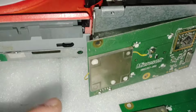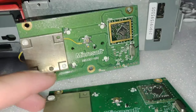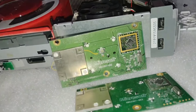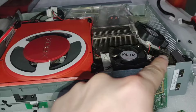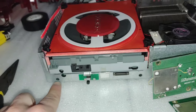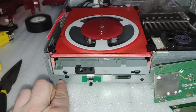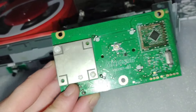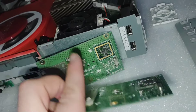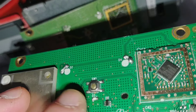To explain this yellow wire — it goes through there right to our speaker, and that's basically a signal telling it that it's powering on, which activates the power-up sound. There's another wire from that board that goes over to where the eject button is, and when you click that it makes the R2-D2 sound that's loaded on there. It's a signal wire to tell it to make the sound because it's turning on. We're going to desolder it from there — that's just where it was on the original ring of light board — and solder it on the same spot onto this one.